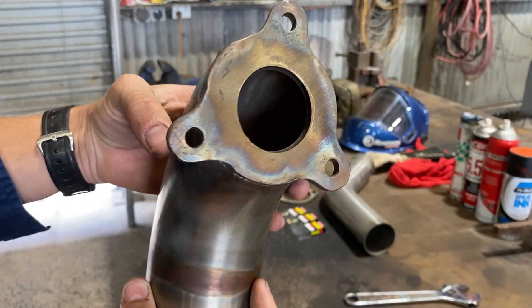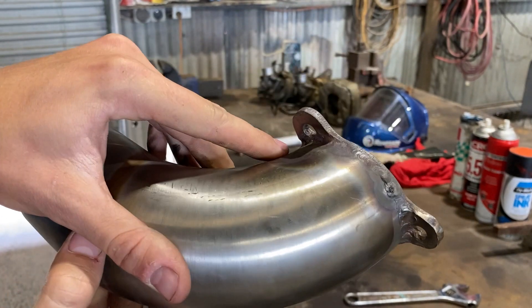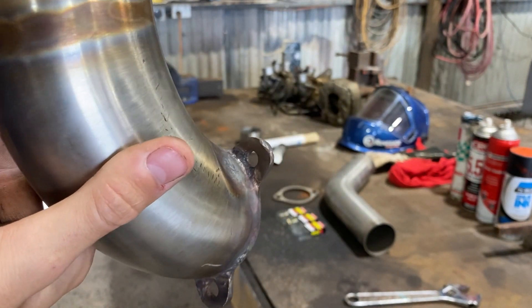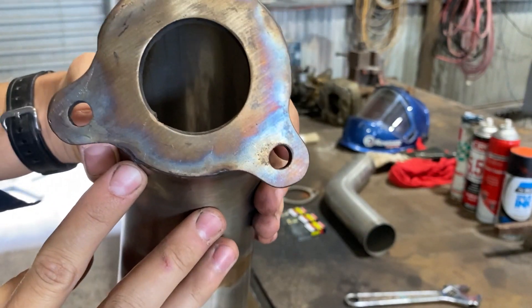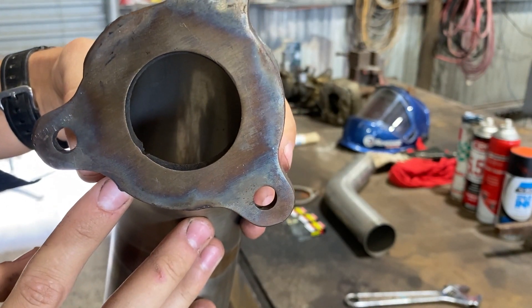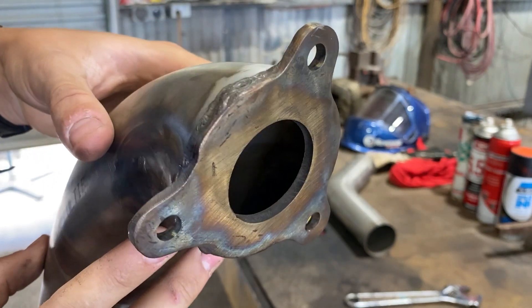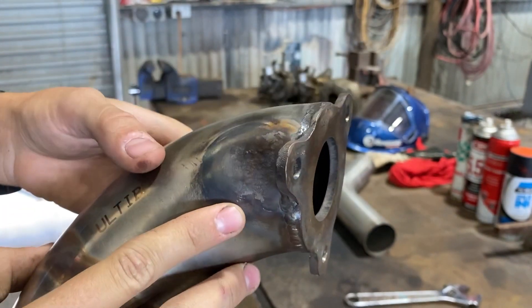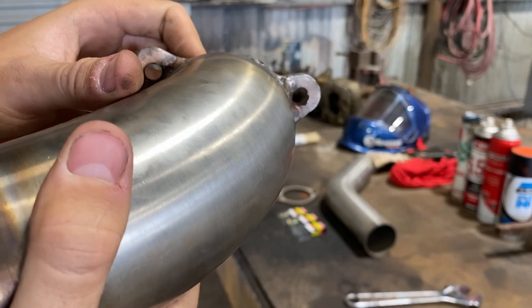Here's what the dump pipe I've made so far looks like. It's these bottom two edges that you want to heat up and hit with a hammer just so it pushes them in a bit. You don't have to worry about it affecting the exhaust flow because that's the turbo outlet size there — you can't really do too much about that, that's just the size of the turbo. No exhaust is going to improve that flow. You don't have to worry about the top edge because that's on the outside of that corner.